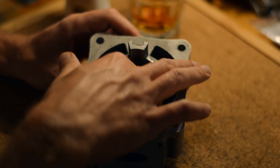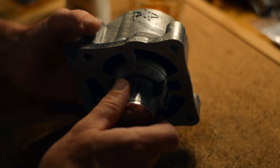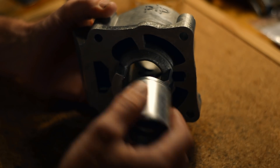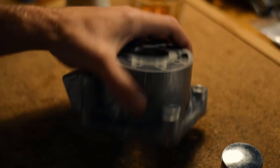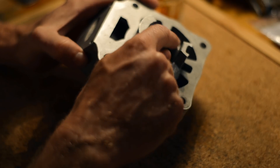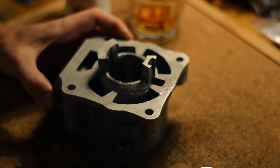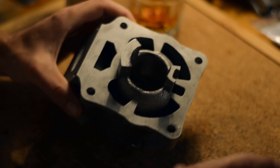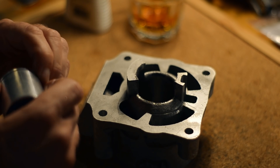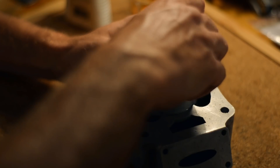I've honed the bottom half of the cylinder — it had a slight taper, it was tighter at the bottom than up top. I went by feel. It's still a little bit tight at the bottom, so we'll probably need to take off a bit more. But I wanted to be able to insert the piston. My nickel seal coating is already gone in some places, so as long as it's not too tight, it's probably better for testing than if it's just aluminium. Anyway, the reason I stopped honing is I wanted to test with the piston ring in the piston, and we have a problem.